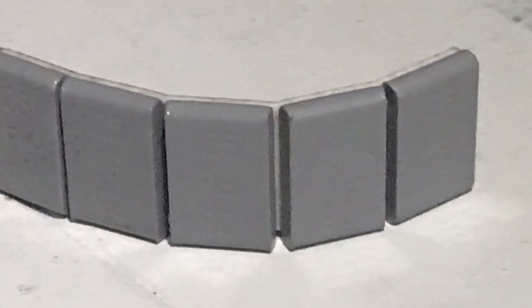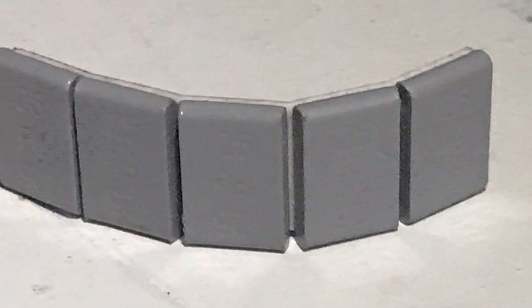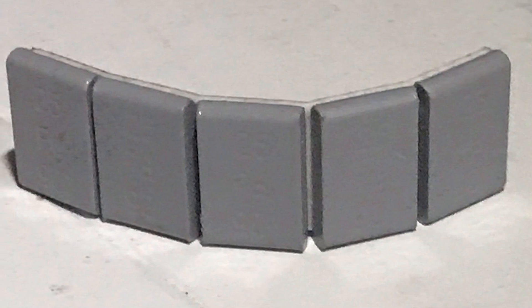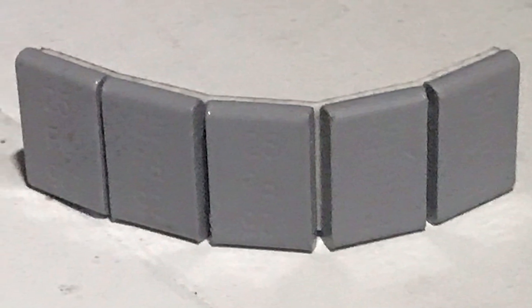Segmented steel weights, on the other hand, usually tear apart easily and can be repositioned if not placed perfectly on the first try, which can save your shop from throwing away an otherwise perfect weight. Another benefit of this style is that when it comes time to rebalance, technicians can typically quickly pry one or two segments to bring the assembly back into balance without having to pull the entire strip off and start over from scratch.